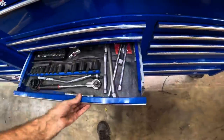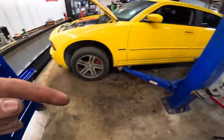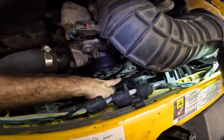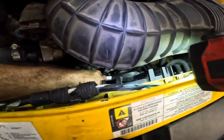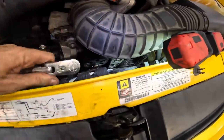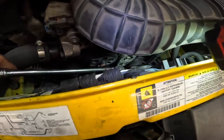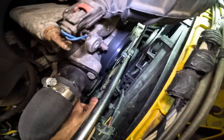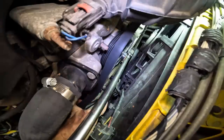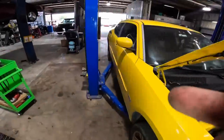I raised the car all the way up and had to let it back down again to get to the serpentine belt. Down underneath the intake tube we have our belt tensioner with a pulley on the end keeping our belt tight. I'm going to get in here with a 3/8-inch drive ratchet, untension that tensioner, pull the belt off, and then once the belt is free we can go back down below and remove the compressor unit.